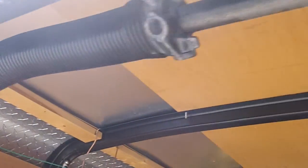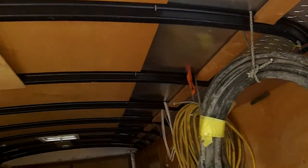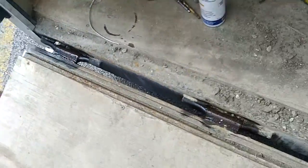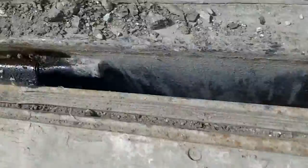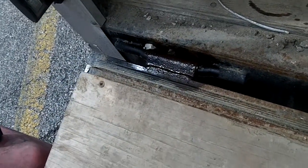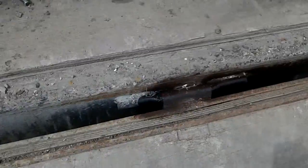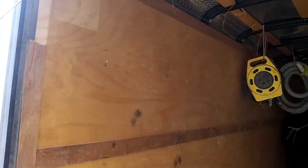We've got some oil on there, and then there's one spring here and another spring over here. When I wound it up it wasn't quite enough turns yet, so we're gonna pop on some more turns and get this big heavy door up. You can see there are four hinges — we got those well sprayed with a spray lube and oil. Next we're just gonna add some more tension and get this cargo trailer door up.